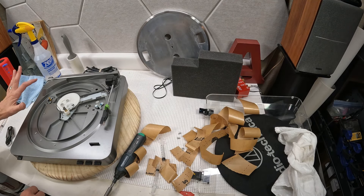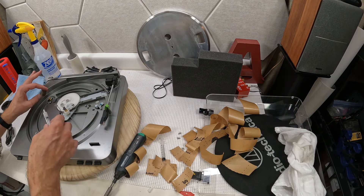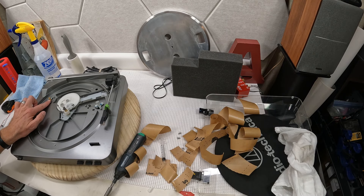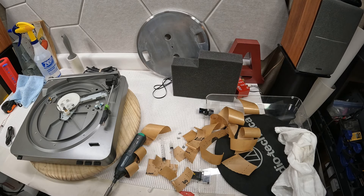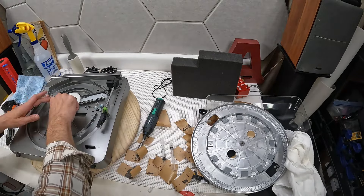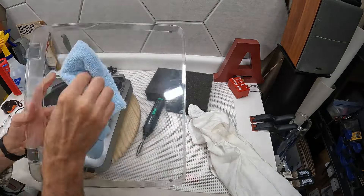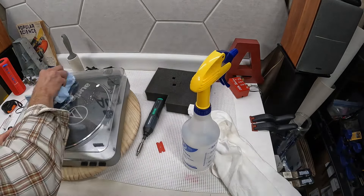What this does is make it easier for the motor to keep speed — the motor doesn't have to fight the resistance. Let's put the screws back on. At the beginning I dropped a little bit of regular Super Lube on here and put it in the top side of the motor. Do not get it on the pulley wheel — that's very, very important. Put it back together. This is one of the most rewarding moments of this entire process — spinning the platter for the first time. It spins forever. Pretty awesome. Now we need to buff that lid: put the Rain-X on there after cleaning it off, buff it on, buff it off — wax on, wax off, and we're done.